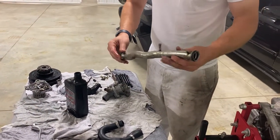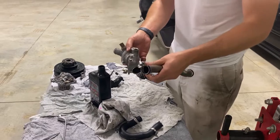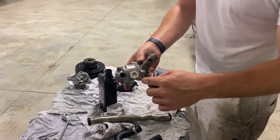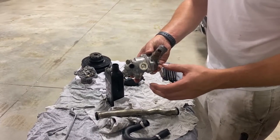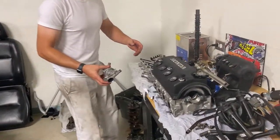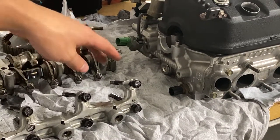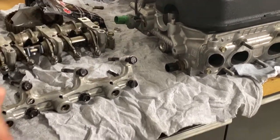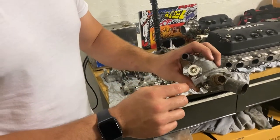All right, so I'll put on the thermostat housing and the water pipe here. This guy's special — this was our heater send. I actually cut it off, drilled it out to 19 millimeters, and then tapped it with a 20x1 millimeter thread, which is what this plug is. This plug is out of a B-series and it plugs the rocker bars in the head when you install them. If you have a D-series, right here there is an outlet for your heater core. There's a hex on it where you can actually spin it out — it's threaded 20x1 — and you can use this same B-series plug to delete your heater altogether. Nice thing about this is it's not rubber, there's no clamp, it will not leak.